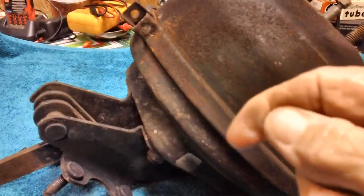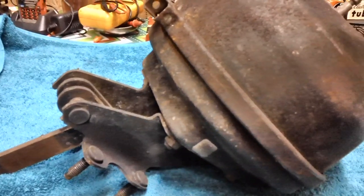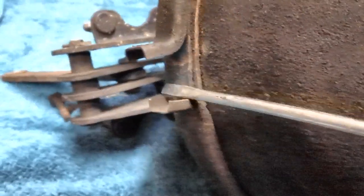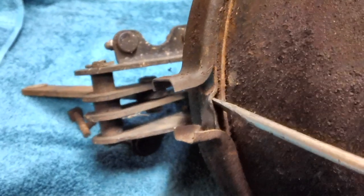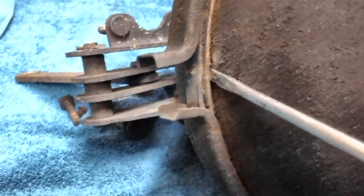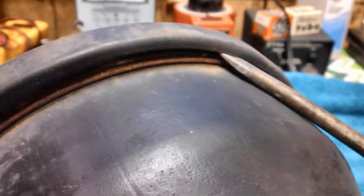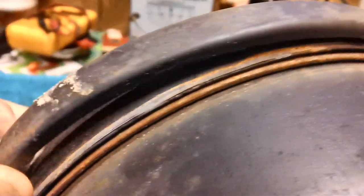I'm going to be very careful to pry it loose all the way around, take my time until I can hopefully slip it back this way — there's less distance to go. Well, there is apparently a rubber seal that fits up inside this thing right here — you've got to keep this from having vacuum leak out of it. That's the way they did it. This rubber thing and the piece below it — we'll keep working and find out. You can get a better idea of that rubber seal now — underneath it doesn't look like it's in bad shape.